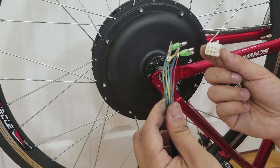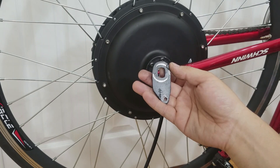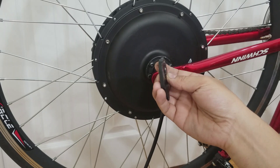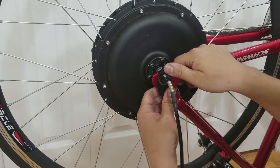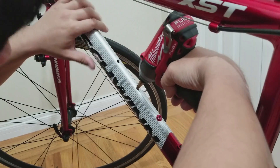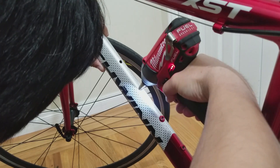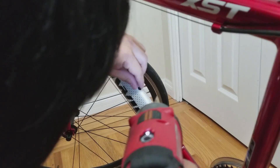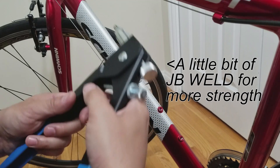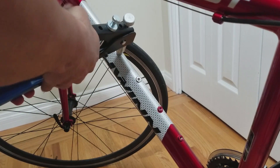For the other side I had to de-pin the connector so I could remove the washer and nut. I then made a torque arm from an old brake pad because the backing plate was 4mm thick. The next step is to install the battery mount bracket — it normally bolts to existing bottom mounts, but on my bike the bottom mounts don't line up correctly. So I had to drill three holes into the frame and use 5mm rivet nuts to make my own mounts. Be sure to use steel rivet nuts because the aluminum ones are too soft and will strip easily.